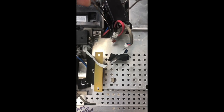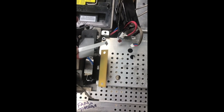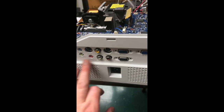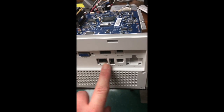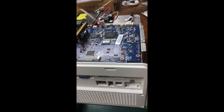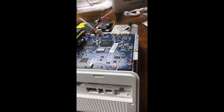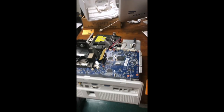Make sure those cables are up — you have your thin ribbon cable and the larger ribbon cable. There's a blue fan cord close to those, and then the red and black. To get the board piece in, all these connections have to go through. The connections here are actually on a smaller board that plugs into the main board, so it could become separated when you pull it out — just make sure it's properly seated or those ports won't work.